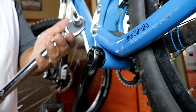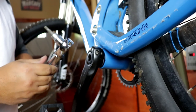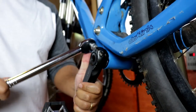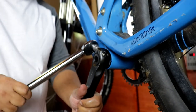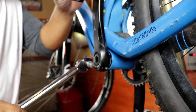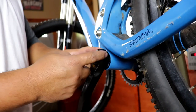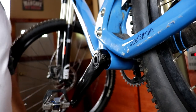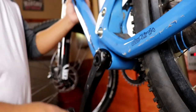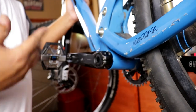Tighten it just until you get to that little bit of resistance. From there you're ready to use your torque wrench. I've got this already preset to 13.5 — around 14 Newton meters. We're going to tighten this down, alternating between both sides so it doesn't go on unevenly. We were able to tighten both up to the correct torque and now we are finished. Just by the action and play in this, it is very very smooth — this doesn't appear to have any creaking so far. Let's take it out on the road.